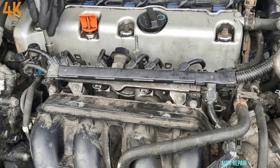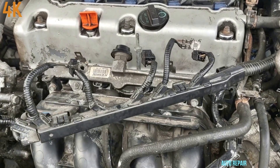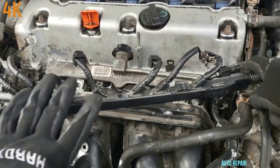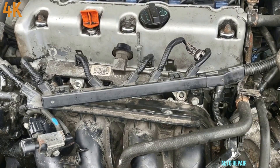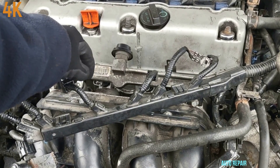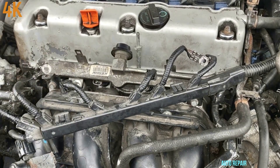10mm bolt here, and another 10mm here, and another ground here. This is another 10mm bolt here. The other two injectors right there. Now the fuel rail — this is a 12mm nut and another 12mm here. These are for the fuel rail. Now I gotta disconnect the fuel rail from here — some gas spilled. Now what you gotta do is pull the fuel rail up and pull it evenly. I cleaned some dust with a very small air pump, because usually there is a lot of dust and garbage when you take the injectors off, and that garbage can go inside the engine — so be careful with that.